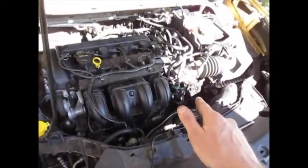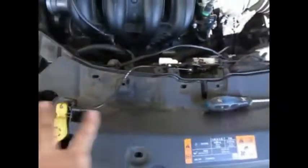If you have a Ford Escape, your transmission oil cooler is right down there — see if I can get my hand down in there. It's not up here by the front. Don't even search up there — I had half the front bumper off and my intuition started telling me I wasn't seeing the transmission lines anywhere up front.